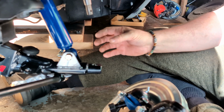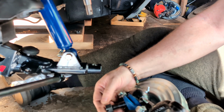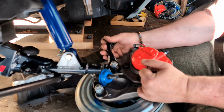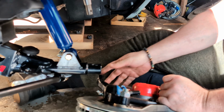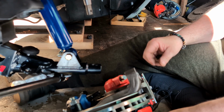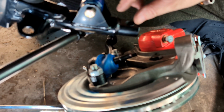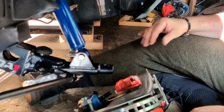All right, so yep. Lower nut. Well, let's see. How are we going to do this? Not sure if you can see it. I'll tilt you. We have our lower ball joint here, which we have to slip up into here. Throw a nut on. Hopefully we aim for this upper one at the same time, while this weighs like 100 pounds.